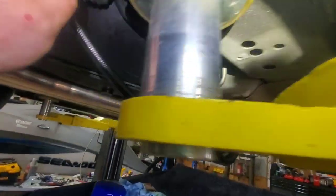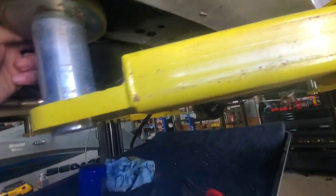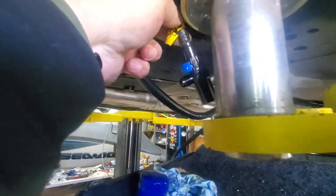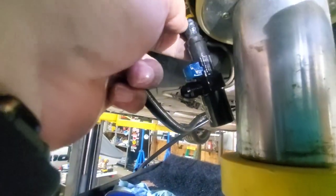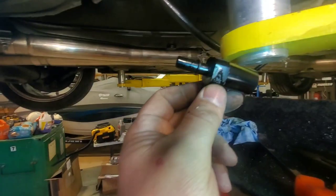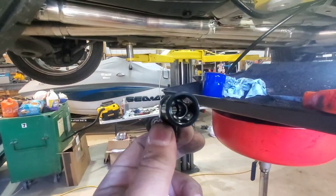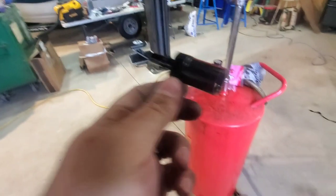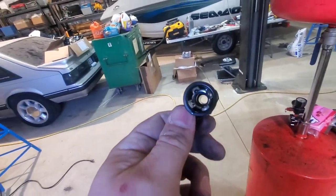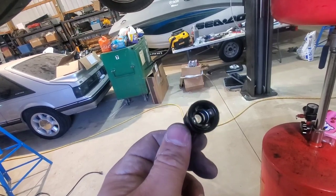The fuel line up here — I kind of slipped the fitting on it already. There's where it goes, with the blue tab there. You have to pull this tab down. I just slid it back off. This is kind of like the stock connector, so you push that in, then push the blue tab back in, then push the other line back into this. From then on you're going to need that tool that goes around the line for the quick release.